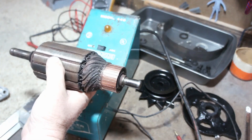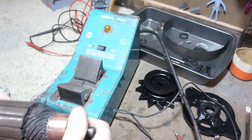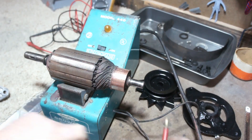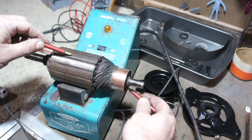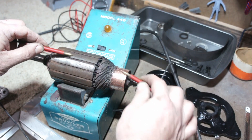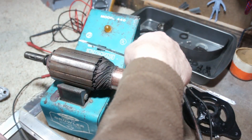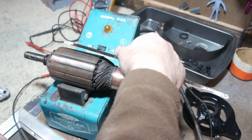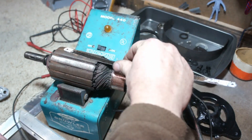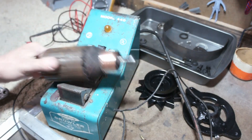This is the one that came in the generator. It is quite very worn down and it was having problems in the vehicle, according to the owner. We can test for armature grounding this way — and that seems to be fine. We can test for an armature short, and I can feel it humming there even. And she's twanging like a hillbilly with a juice harp. So that armature is shorted.